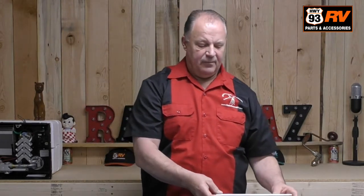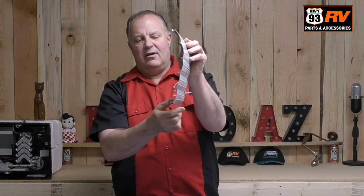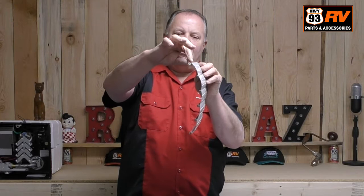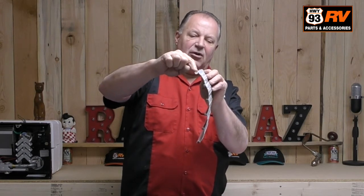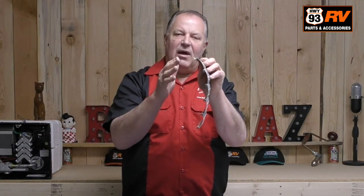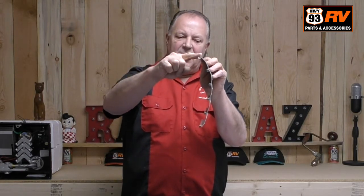Now the A&E one, see, it doesn't have anything that goes into the awning rail. What it has is a slot here and a slot here. Now I don't have a fabric for this, unfortunately. So on an A&E, this fabric would extend up here, then you'd have the bead here, imaginary area, that would go into the awning rail. Then there would be a bead that goes into here, then you'd have fabric, and then a bead here, and then fabric going to the roller tube. So an A&E awning with a metal weather shield actually has 5 beads or 5 polycords in it. You'd have one up here at the awning rail. This would be number 2, number 3, and 4 and 5 would be at the roller tube.